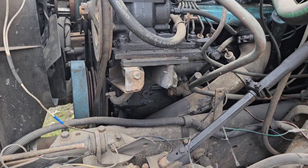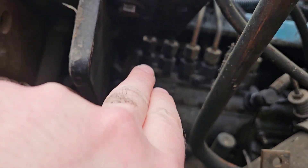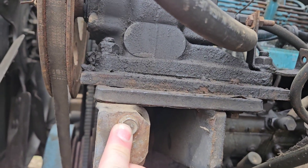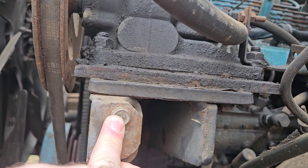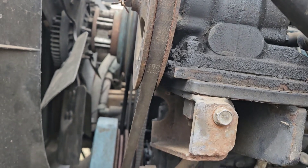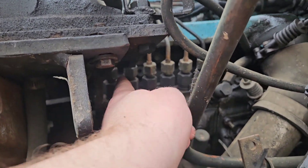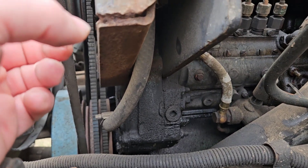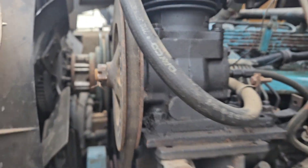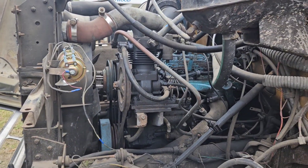To pull it off, as you've seen from my water pump videos, you've got four bolts — one here, one here, one here, and one right here. We're going to undo these, and then this is our belt tensioner. We'll unscrew it, which will push this further back and slide the compressor in. Then I can take the platform off. We've got one bolt here, one bolt here, and then the top bolt. These bolts right here have to be undone with the platform off, so we're going to go ahead and take it off. We're fighting the weather — it is going to rain here soon — so I want to get this done quickly.